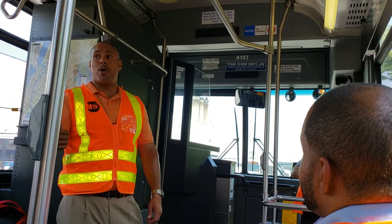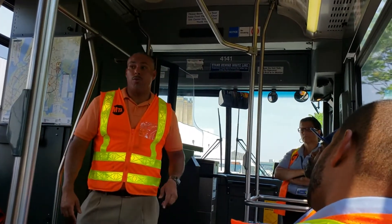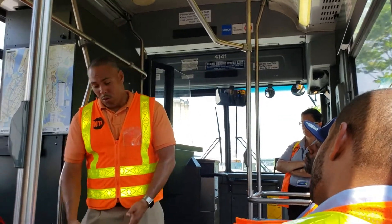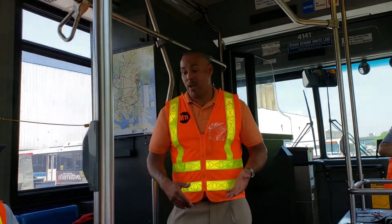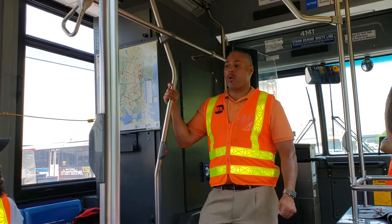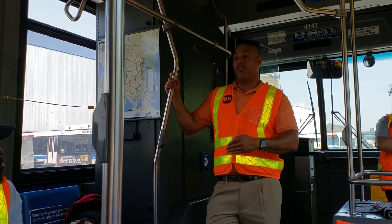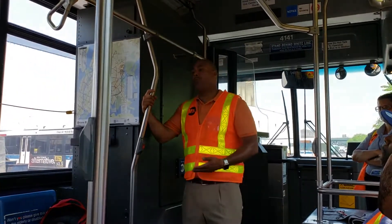After that, perform your parking brake test. With the parking brake up, hold down the service brake, put the bus in drive, and hit the accelerator — it doesn't go anywhere. The parking brake is working properly. For the service brake test, release the parking brake and move the bus anywhere from 10 to 50 feet at 5 miles per hour, then simply stop the bus nice and easy to let them know the service brake is working properly.